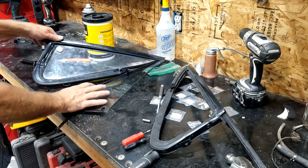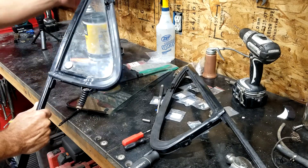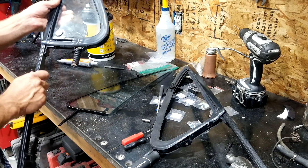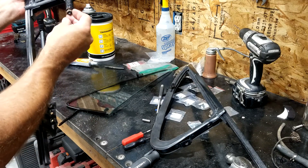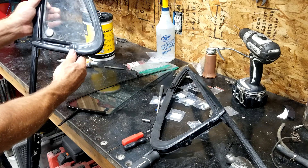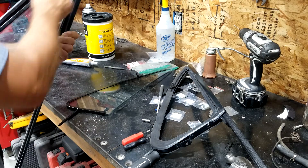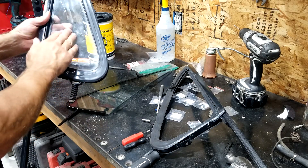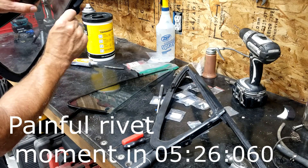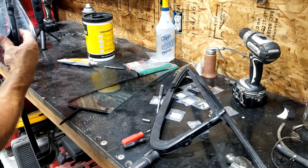This one is pretty much complete. All I need to do is attach the back weather stripping. This frame was in pretty good shape, as was the other one, so we cleaned it up and painted it with rust inhibiting paint. Did the same thing with the parts down here. The spring, nuts, and components are all put back onto that one. The glass pane was left in the frame, taped off, and then painted. This glass isn't perfect — it's got a few scratches — but it's fine. I put a basic aluminum rivet into this spot right here to hold the vent window onto the frame.